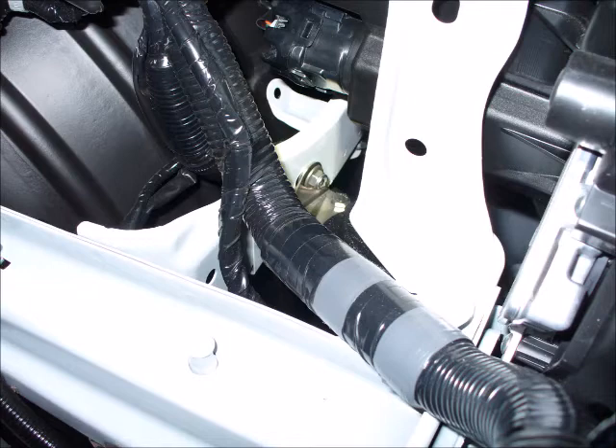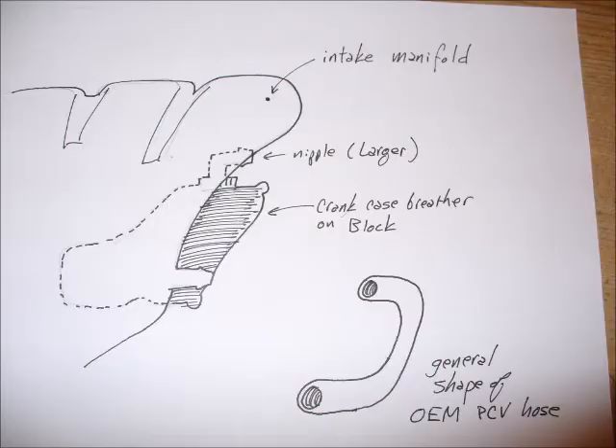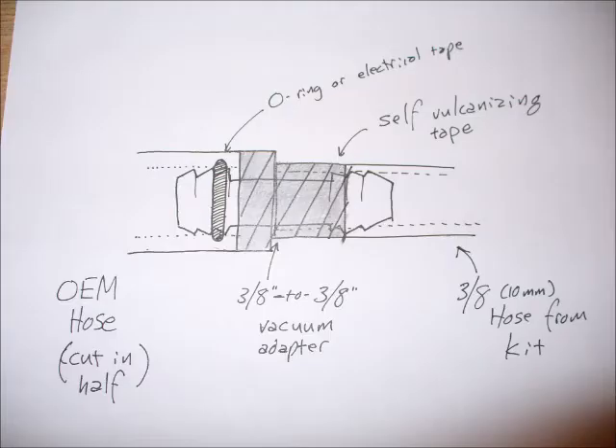This is a 2016 Mazda 3 — specifically the 2.5 liter. You can see the very top of the oil catch can mounted right behind the driver's side fog light, with the airbox removed. There are two things going on here: one is the C-shaped OEM vent hose, and the other is this dark area where the upper nipple is. This nipple swivels, which makes fitting a small 3/8 inch hose onto it very difficult.